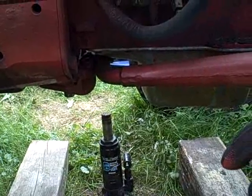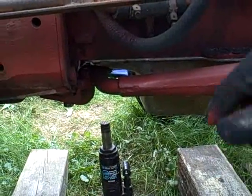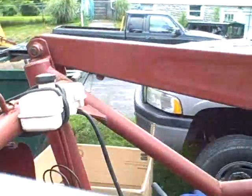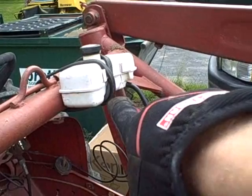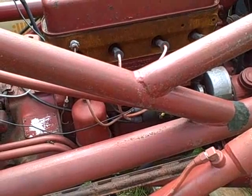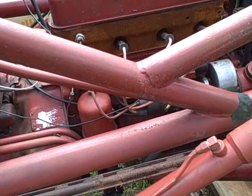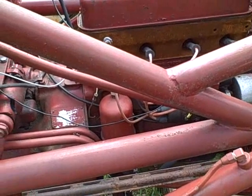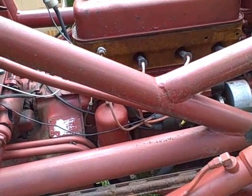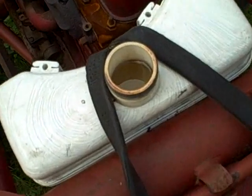The engine died out again and the first thing I did was check the fuel tank — it's empty again. This thing is sucking down gas. It's a 175 cubic inch engine and I topped off that little lawn mower tank and it seemed to suck that down really fast. I checked my oil level in the crankcase and it's not rising to indicate fuel is getting into the crankcase, and there's nothing leaking out of the carb — just a little seepage around the bowl gasket. It seems like it's just burning all that gas. I'll top it off again.